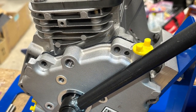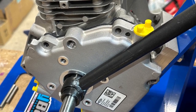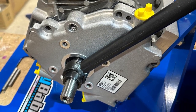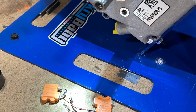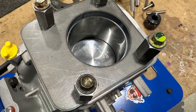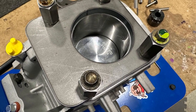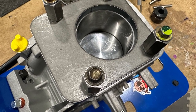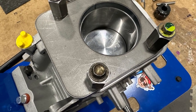We just had the side cover off so that you could see all the mechanics of what was going on. But in order to do this procedure there is no reason that you have to take the side cover off or even touch the orange locks to complete this task. We cut the locks off this brand new engine just so you could see what the camshaft looked like, how the lifter sat on the cam and how things aligned. Now that the plate is securely fastened to the top of the deck of the block, we're using our made spacers so that we can reuse the existing head bolts so that we don't have to get different ones. Everything is now in place and we are ready to go to the outside and put our bar on and adjust and calibrate the cam timing.